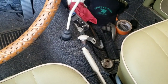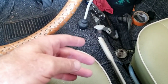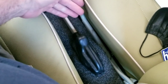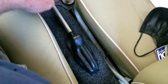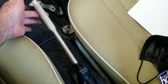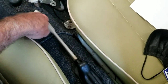If that's the case, you want to know that the e-brake cables weren't adjusted first. Some guys actually go and adjust the e-brake cables and tighten them up real tight because they think their brakes aren't working. You should always adjust the brakes on the wheels first and then adjust the e-brake cables. As your lever gets higher and higher, that tells you that you need to adjust your brakes.